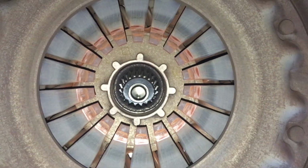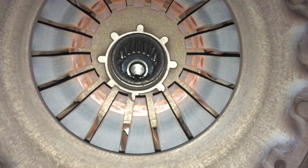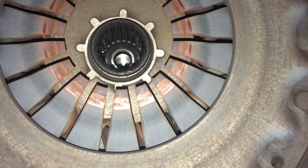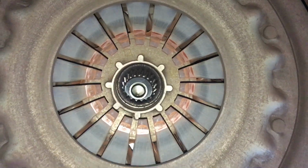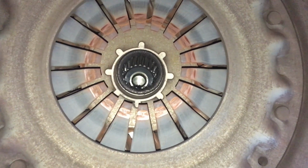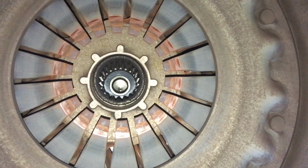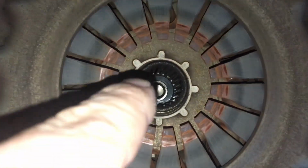We'll go and have a look at it on the gearbox in a minute. But if you've got a noise, for example, when you've got your foot, let me get it right here. So when you've got your foot on the clutch, I have to think about this, hang on a minute, I'm confusing myself. Okay, I think I've got it figured out. Anytime your foot is on the clutch, the input shaft of the manual transmission can spin at a different speed to the engine, right? So remember, that's your engine at that end there, and that's when that bearing there's spinning.